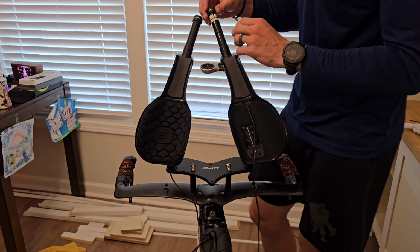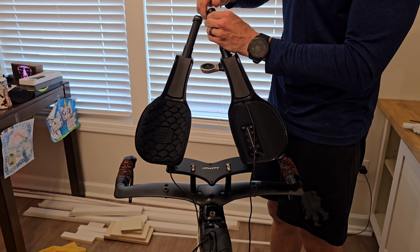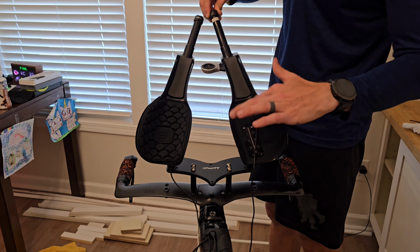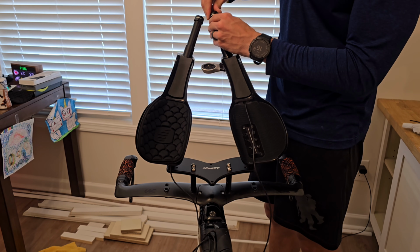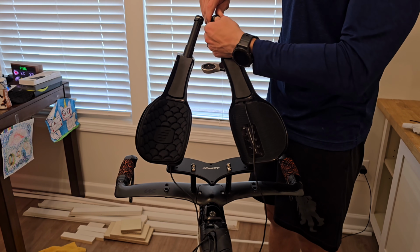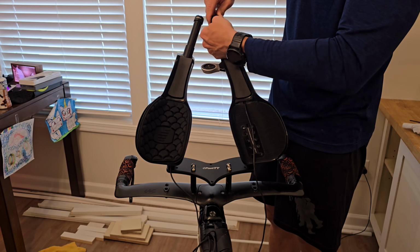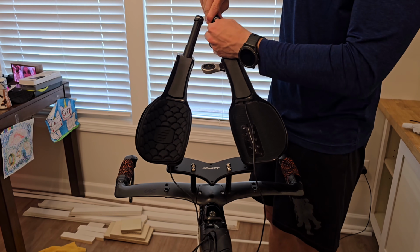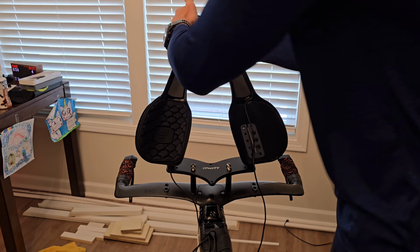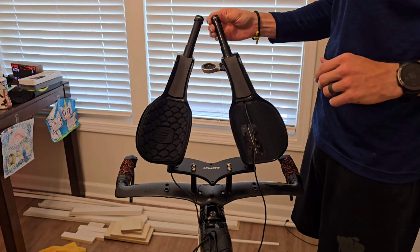Undo it here. These are ready at the top. What you'll do is you'll tighten one direction and then it'll loosen another one. So we're going to place this one in, loosen it up a little bit. We'll twist to the right and hold the bottom piece still, open it to the right. We'll slide this in. Make sure it's spinning freely down here. You don't want to force this in. Make sure it goes in. There you go. And then you'll hold the bottom here, and then you'll twist this. And when you want it to get aligned, we just move that, allow that bottom piece to move freely. And we'll tighten it back up. It's just like this, and then tighten it up. And we're about right where I want it to be, so I can see the Shimano. I can see it has a good grip. All right, that's about good right there.